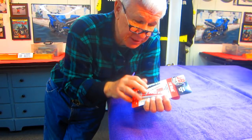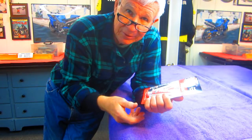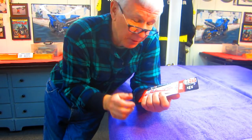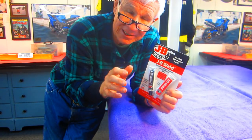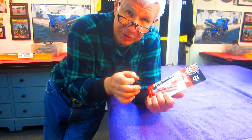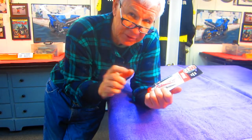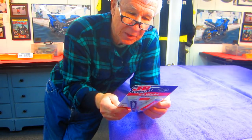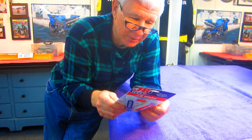By the way, there's another material. If you're fixing an engine, you have a broken crankcase or a cylinder head even, and I've done this on a boat, so I know it works. There's a material you can buy in West Marine called Marine Tex. They're about $35 for this amount. And that material, you can put threads in it, and you'll never break the thread. It's amazing stuff. It's called Marine Tex. I guess you can buy it on the internet too nowadays. We fixed a boat engine years ago, remember, the wooden boat.